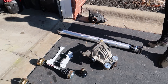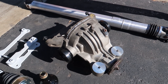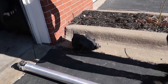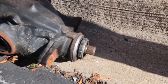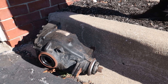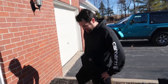It's just the bee's knees. We've got the big old billet stubs that come with our kit. Look how shiny and nice — this is how they come from us, all cleaned up. You can order a diff from us online. And this disgusting non-M diff with the input flange — that's a joke. We've blown up so many of these. This is a 188mm ring gear; when you compare the pinion size to the Ford, it's honestly almost double. It's insane.